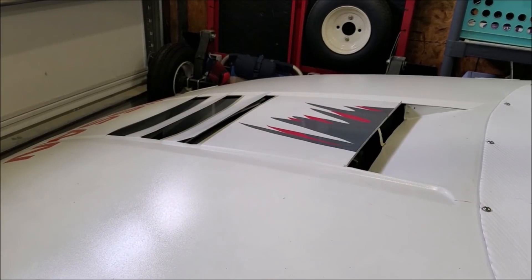For those who watched the overview video of my 350z race car, you know that I have these vents in my hood to try to not only improve cooling but also to reduce lift and drag. The idea is the air that comes into the front of a car and goes through the radiator has to go somewhere. In a normal car with a completely enclosed hood, that air gets trapped in the engine bay or exits from underneath the car, causing lift. Any air that gets trapped causes drag and reduces cooling, because cooling only works if you continuously have air flowing through the radiator. If air backs up inside your engine bay, it creates high pressure and limits airflow across the radiator. For this reason, all performance cars and race cars have hood venting to keep air moving.